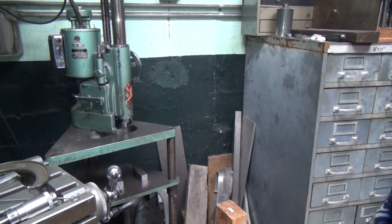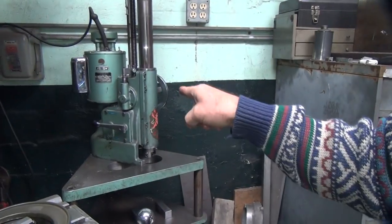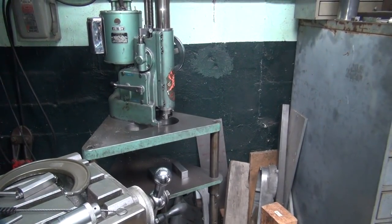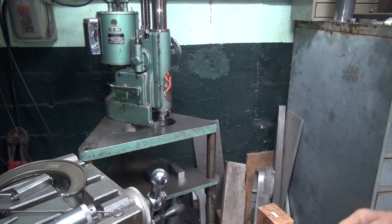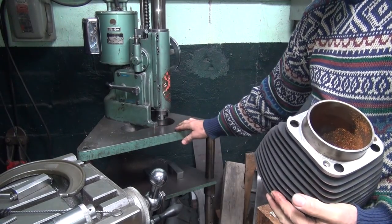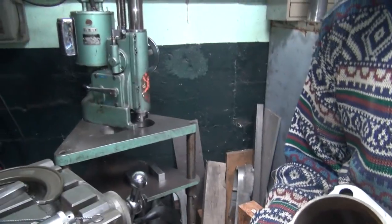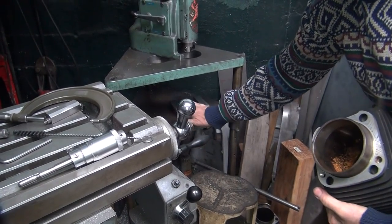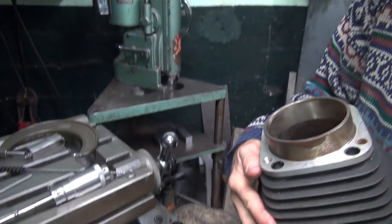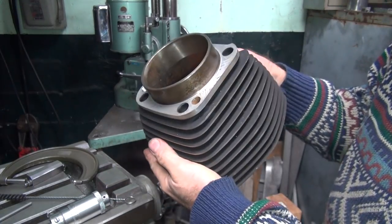Some people were shocked about how boring bars work. They're like milling machines except a lot stronger and a lot more accurate - similar, except the table doesn't move. Basically you've got an inch and a quarter plate here that's flat ground. There's a jack on the bottom that you jack up to push the table all the way up. The table has three legs that slide up and down on some big bushings, and it pushes the cylinder up against the top plate.